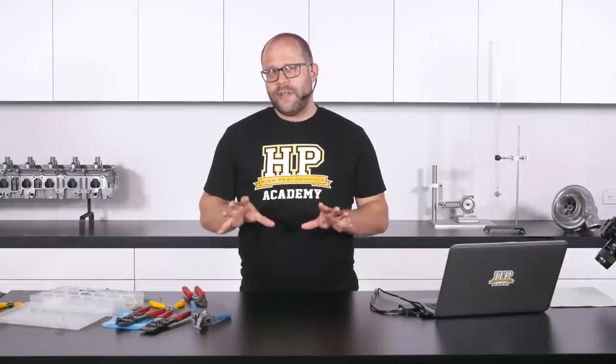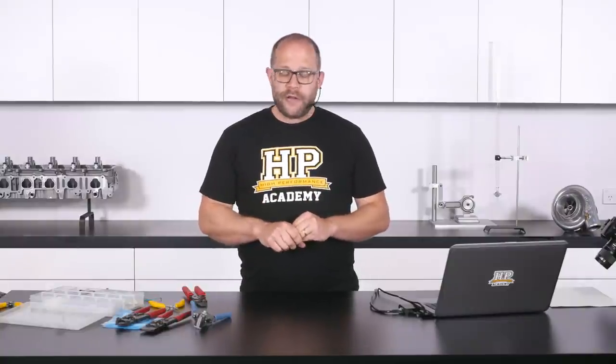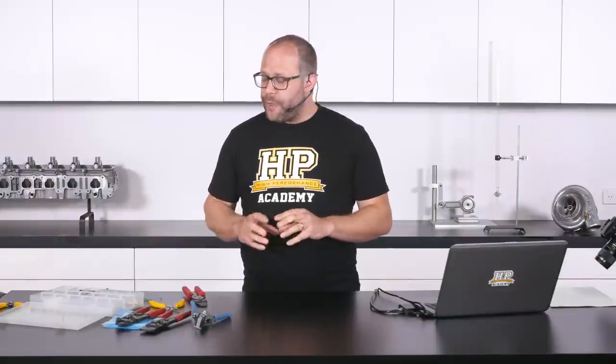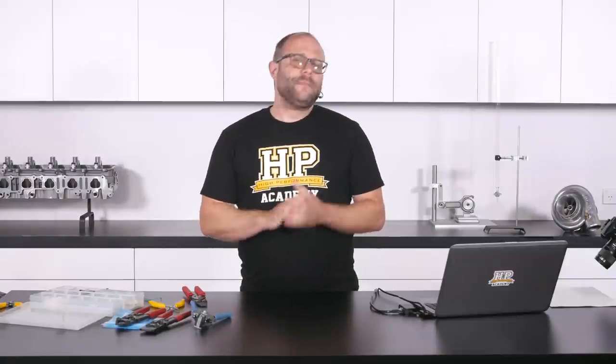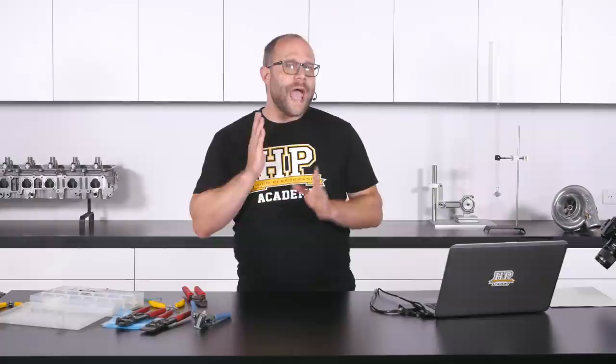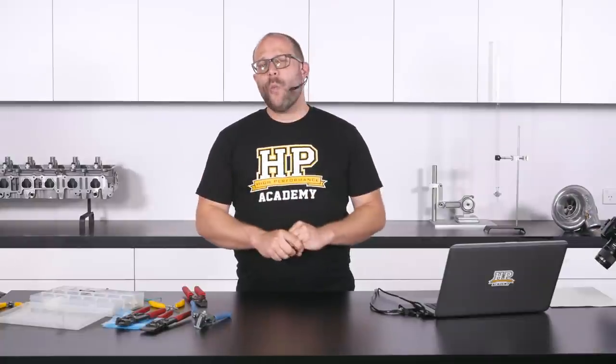We're going to look at it in quite a bit of detail and get into a little bit of the math behind sizing the splice — talking about how we determine the amount of copper that we're actually going to have in that splice to make sure we're going to get a really reliable join. So the first thing I want to talk about for splicing is where we're actually going to try and locate those splices in our wiring harness.